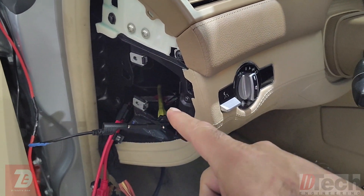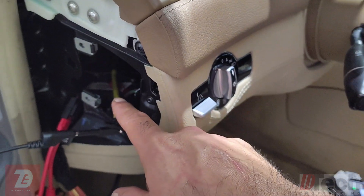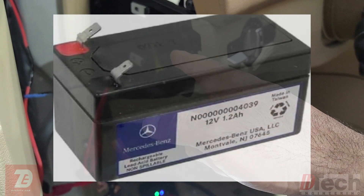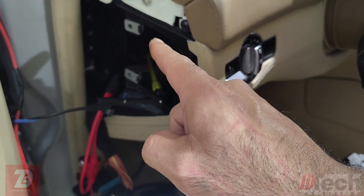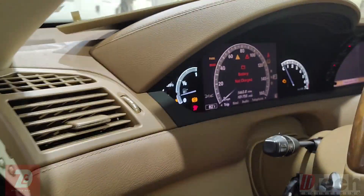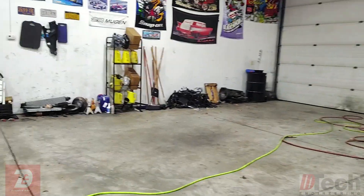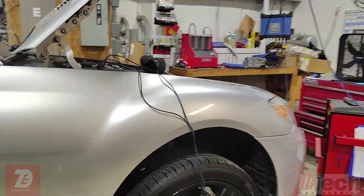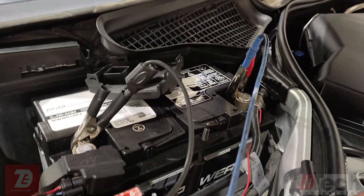Frankly, it's pretty straightforward that the auxiliary battery would need to be replaced. On this chassis it lives down there — you can see the white sticker. It's one of those mini batteries commonly known to drop down. So I decided to look at that since they did put a battery in it. The auxiliary battery is actually charged up — with my voltmeter outside the car it's at 12 and a half volts.